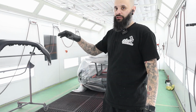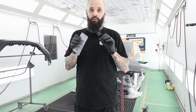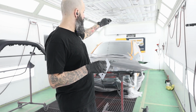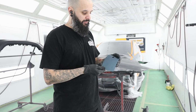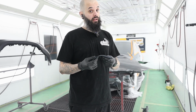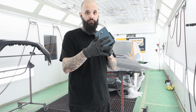I've got a bunch of new parts. I'm not gonna really focus on spraying the new parts. I'm primarily going to focus this video on our blend fender, blend door, and blend rails, and show you how I handle difficult colors, because this color is not 100% perfect. I'll bring you in and show you that this isn't perfect, but I'll show you how you can make this look perfect by blending.